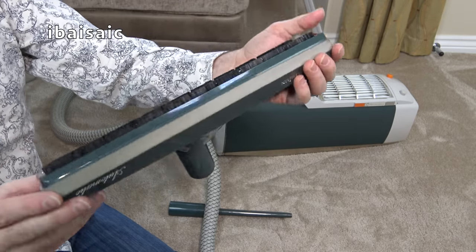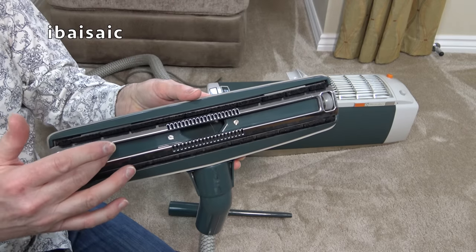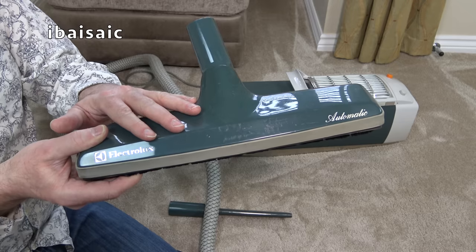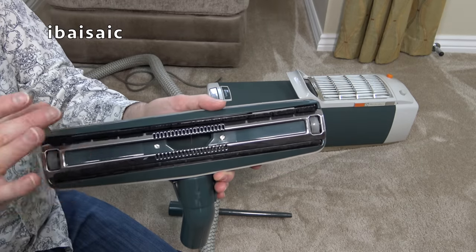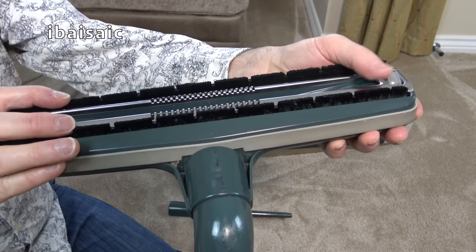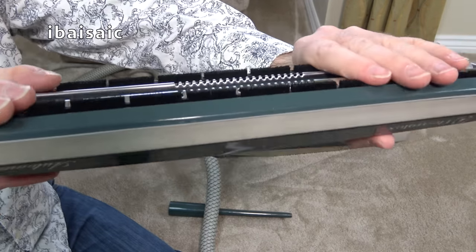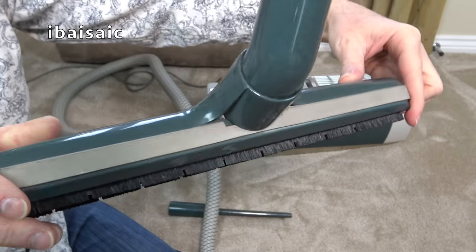I bought a separate brown head on eBay that looked quite in good condition until I opened it up - and it was absolutely caked, packed full of dust and fluff, which meant the automatic feature didn't work. There's a little membrane inside here. Basically, when the suction gets restricted, these brushes should pop down for your carpets. That's the carpet side. When you go onto a hard floor with more airflow, then the brushes stay popped out. You've got a nice wrap-around furniture guard.